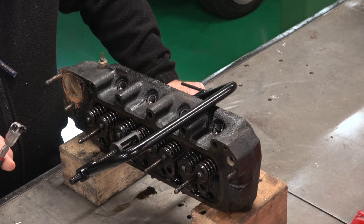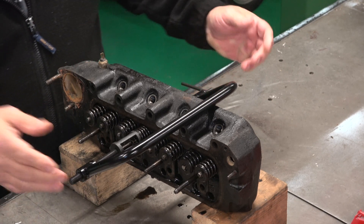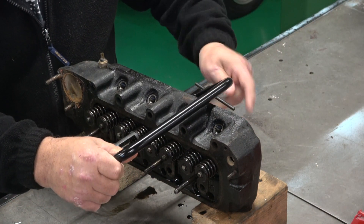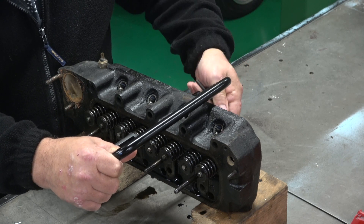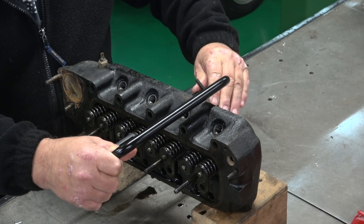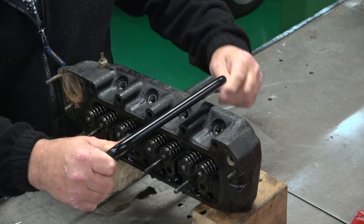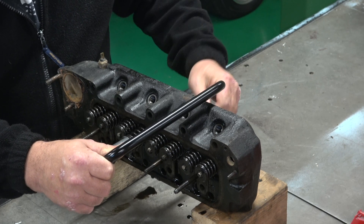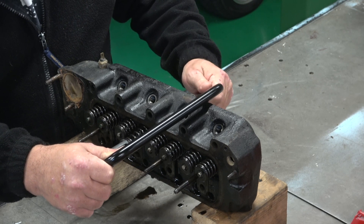Anyway, that's the contact number there. As you can see, I've got the valve spring tool fitted on it. I've put the two collets out — you can see them there on the end of that magnet. It's nice and firm, good and solid. All I'm going to do now is just release it back and take the pressure off the spring. It's very basic but effective. This is the cylinder for compression and I believe it's the exhaust that's causing it.